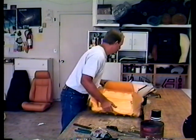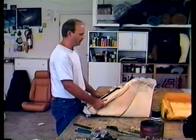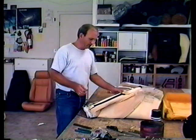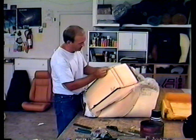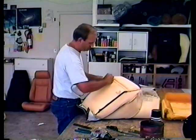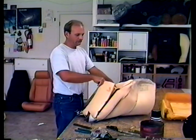If you're a professional, you can feel the wire and won't need to do this, but it makes it very easy to just be able to see the wire. On the original cover, something GM does is sew foam into all the covers so that they can put different covers on the same seat. Take a razor blade — there's big foam in here that we want to glue back on. Just run the blade down along the seam and take out this piece of foam.